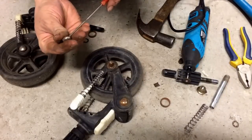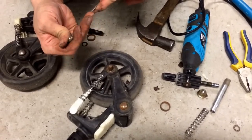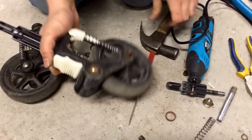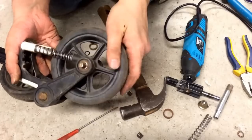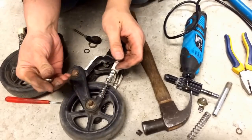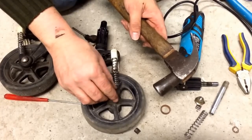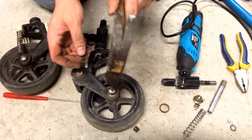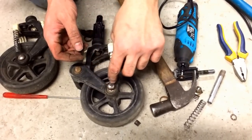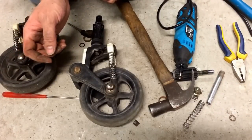The same principle applies here — some of the teeth will be bent inwards, so you want to pry them out so that they're flat. This is a little bit too tight, so I'm going to have to relieve some of the pressure first by hammering quickly on the shaft. The trick with these is to either use a spoon and then hammer it, or what I will be using is a spare inner tube that I'll fold over a couple of times and place over. This will help to evenly distribute the pressure from the hammer such that it hammers it down without denting the bulbous head and affecting the structural integrity. I hope this video helped — feel free to leave any questions and comments.